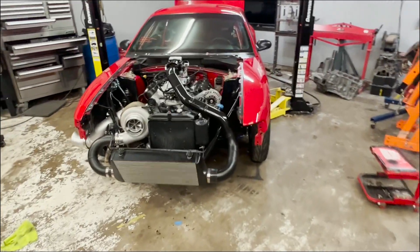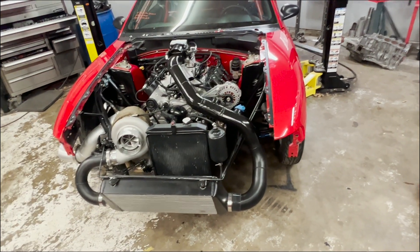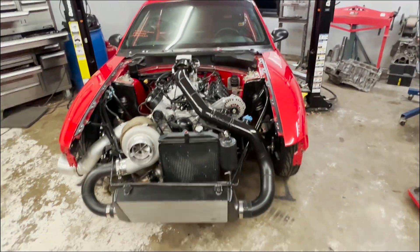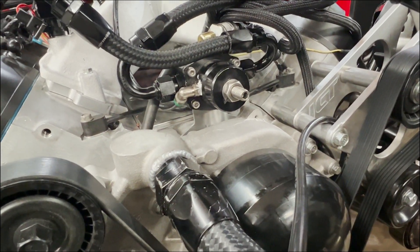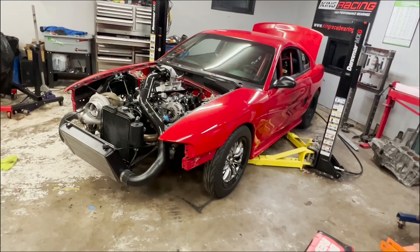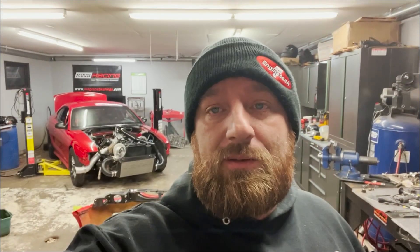We got it all pretty much buttoned up. Got the pipe re-welded and sitting in some fresh paint — a little glossy here while everything else is drying to a satin finish. The car runs. I fixed the fuel pressure issue — a fitting going into the side of the regulator was going too far in, hitting the spring, and keeping pressure up. Pulled that out and fixed it. Car runs, good oil pressure. Now we just need to change the oil after heat-cycling it, button up a couple other little things, and we can get it out and test it.